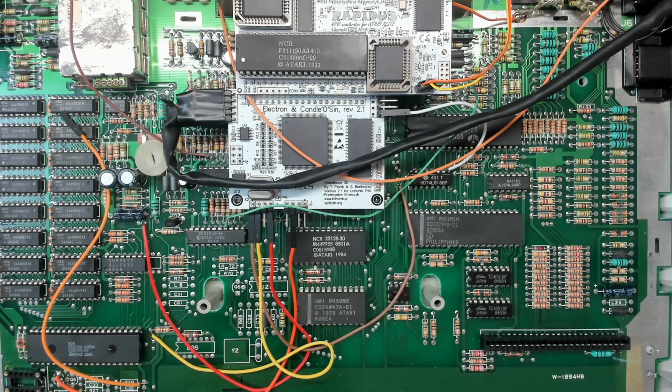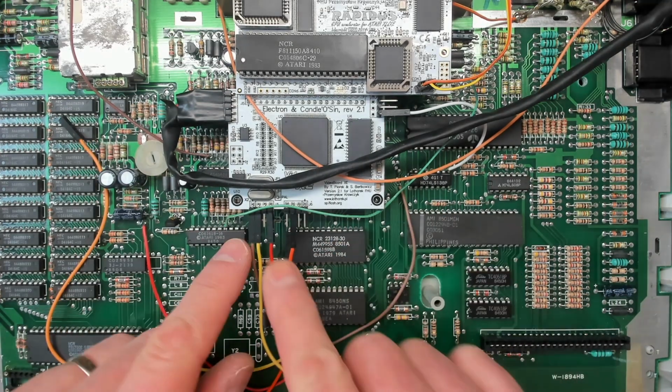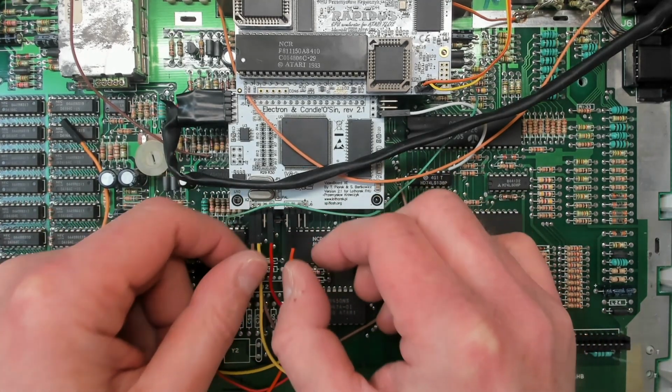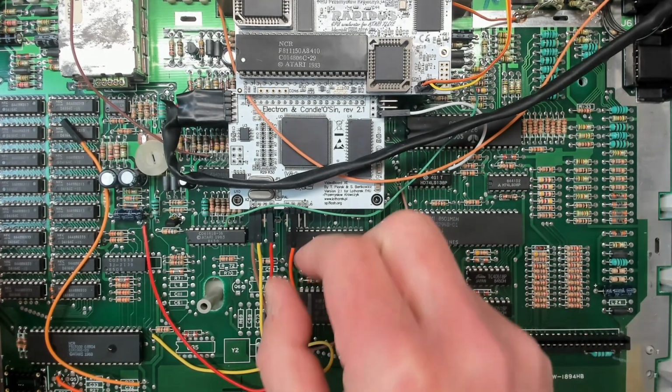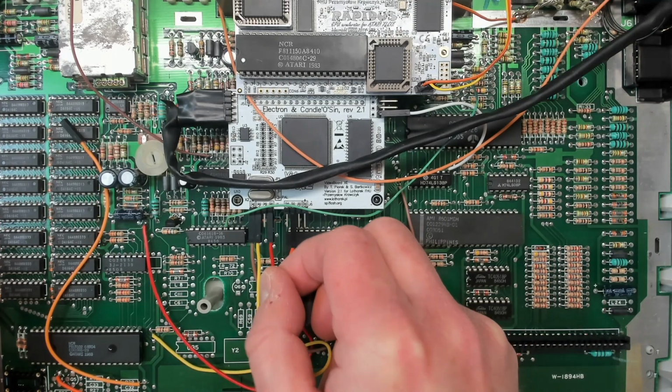I mean, come on. So that's what I'm going to do. I'm going to replace these with 4-way housings. If you have a 4-way housing on these two here, you've got the combined friction of however many connectors are actually present holding the thing in, whereas if you've got one loose one here, it's just going to fall off.